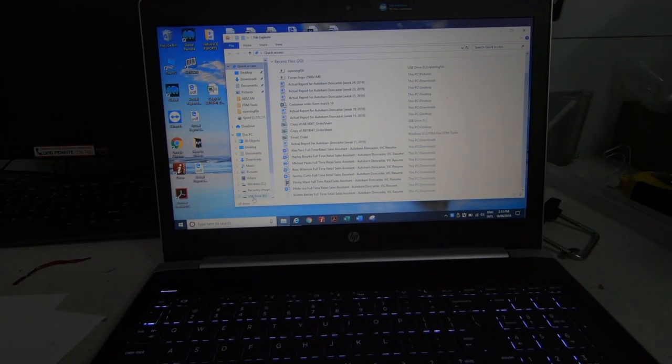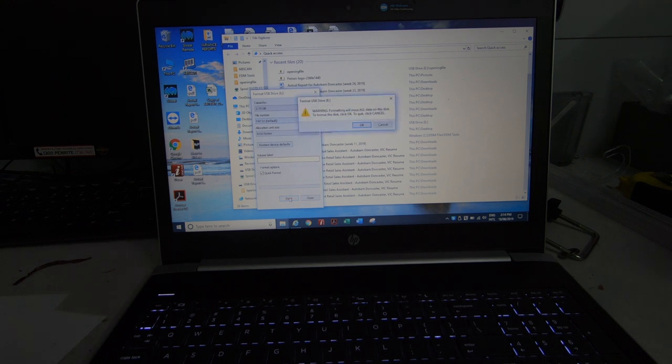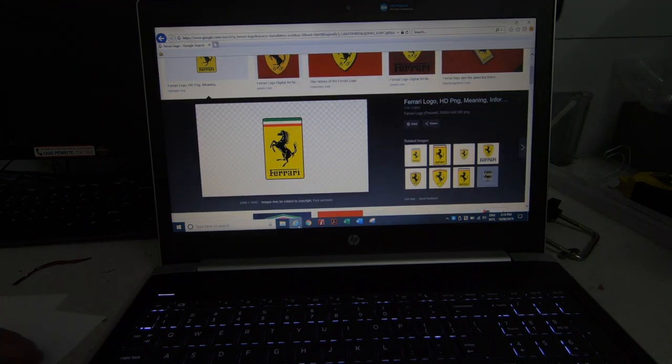Once you've got your Windows computer, plug in the USB. Then scroll down to where you see the USB and first thing we want to do is format it to FAT32, which erases everything on it. Format complete — we now have an empty FAT32 USB plugged in.